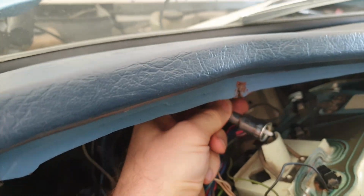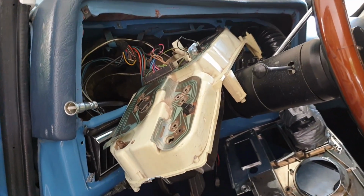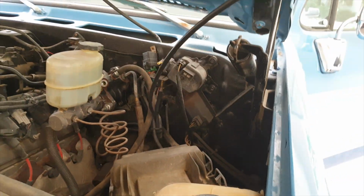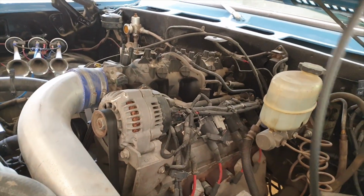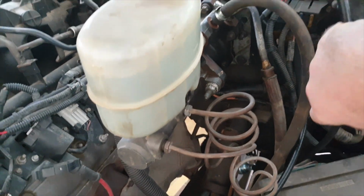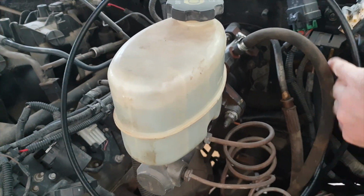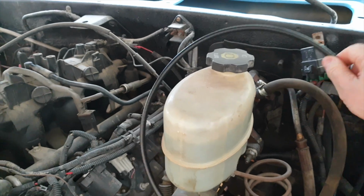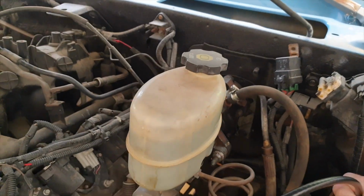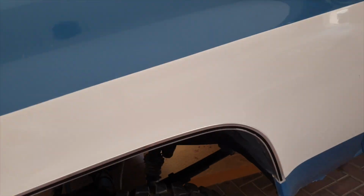That's perfect. I want to do this end first because I want to make sure that everything's connected before I put the dash back in. I'm not going to finish that now because I want to check the lights work after dark. We'll do a session on that. The Speedo itself needs to go down very close to the bulkhead, so I'm going to thread it down here, and it is tied to the bottom of the car. Thread along here, so push everything through. Thread it down here.